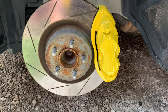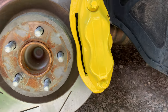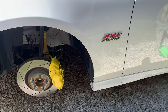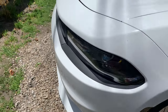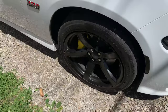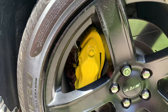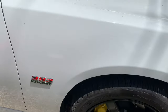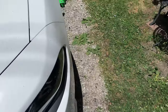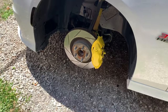This one just had a clear coat — looks really nice and glossy. It was red before but started getting bad after a year. Without the clear coat you can see it's not that shiny. You just clean it up, sand it down a little bit with 100 grit, and use some brake cleaner to clean it up nice.